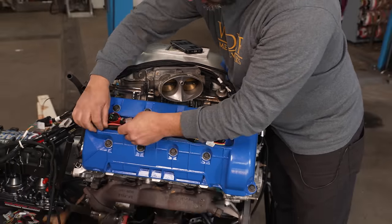So I decided to pull the turbo apart so I could get it all mounted in and then clock it properly. And I'm glad I did because I'm finding bits of the old engine stuck to this exhaust wheel. There's no chips that I can see, so we're just gonna hose it off and run it. How much old engine parts did you get? You see here? That's part of piston rings and bearings and stuff that were exploding out of the exhaust. Memories from the past. Yeah. See, I shut her right down as soon as it happened, to try to save everything. The impeller looks mint. Yeah, it is, but it's also covered in actual hard parts.